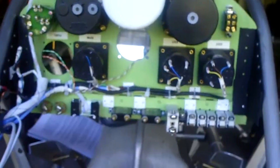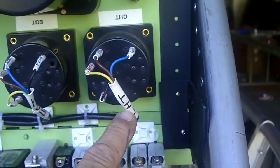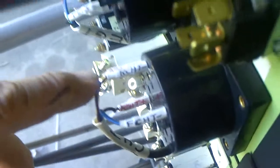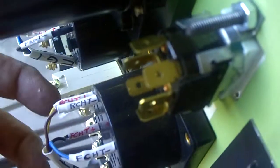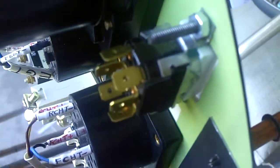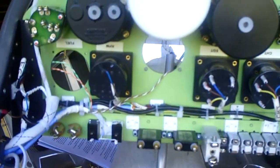Things are coming along. I've gone ahead and put some shrink tube on here and identified what each bundle is. On each of the connectors — for example, this is the forward CHT negative and rear CHT negative, the rear CHT positive and the forward CHT positive. That way I'll be able to put a placard, a decal on the front of the panel indicating which is front and which is rear, so you can monitor your cylinders for the temperatures.